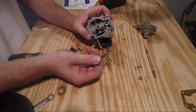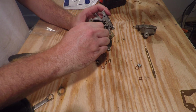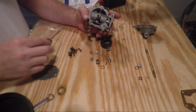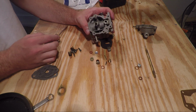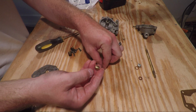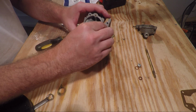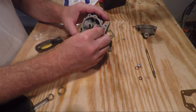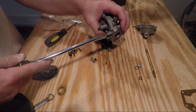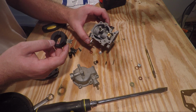First thing you want to do is replace the center brass fitting. Finger tighten it down, and then snug it to seat. Then after that, you want to take your new brass fitting, slide the new washer over, and slide it, and get it good and snug. Once you have these two in place, you can begin to reassemble the float.